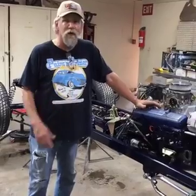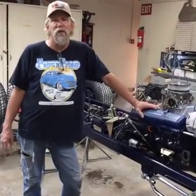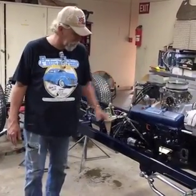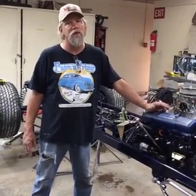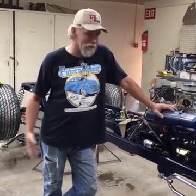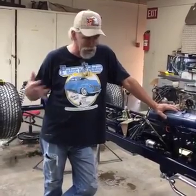It's a good thing, or a battery cutoff switch is a good thing too. If you've got an issue where your car is going to sit for a long time, there's no reason you can't put a cutoff underneath or just disconnect the battery. You should not have to keep your car trickle charged. I mean, if it's continually got a drain going down, if it's not that bad a deal and you don't want to jack with it, and I had the choice between a trickle charger and a battery cutoff switch, I got a four-wheeler at home that I'm fixing to put a battery cutoff switch on because I'm tired of charging the battery. So it ain't worth looking for, it's just a minor draw somewhere.